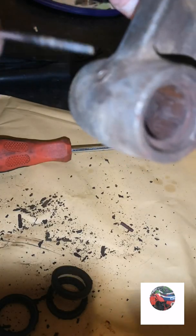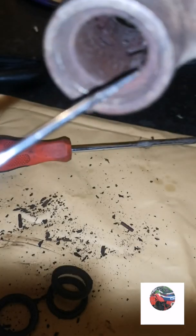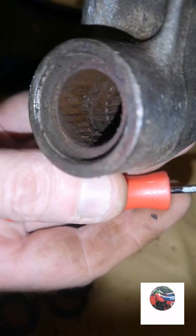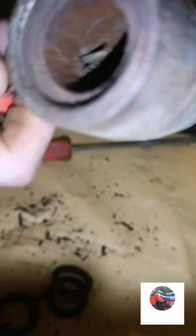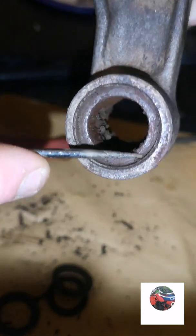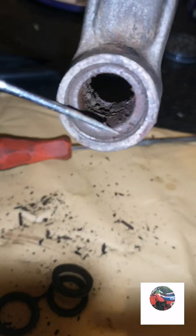When that's filled up with grease, there's a gap in between these two bearings, as you can see. Focuses in. There it is there, look. The gap's in the middle of the two bearings. So you can grease the bearings up, because these always seize. And I just cleaned it up just to show just where the bearings sit.